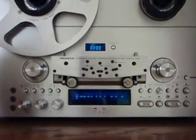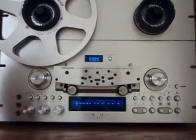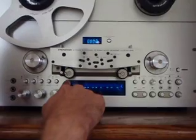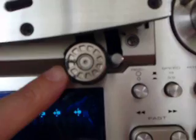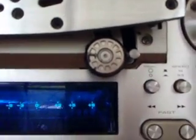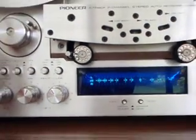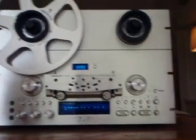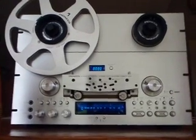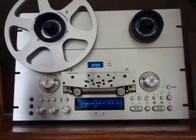The first thing, which I would say is the notable flaw about the unit that I know for sure is incorrect, is these rollers are all gummy and soft. As you can see, it comes off on your finger, and it's pretty messy, but it's isolated just to the rollers, and so I'm unable to run a tape through it because the rollers are so gummy. But from what I understand, that's a common problem, and it can be repaired relatively easily.